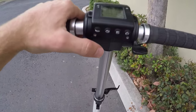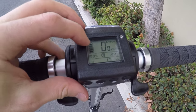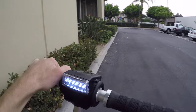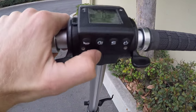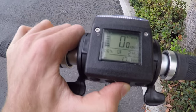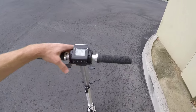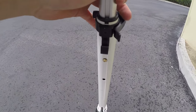Let's look at the display system. The first button is power — it chirps and comes to life. You can see battery level and speed in kilometers per hour. I haven't figured out how to switch to miles per hour. Battery is at 100%. The light starts on by default — it's quite bright with about six LEDs in there. There's also an extremely loud and ear-piercing horn. The S button changes through readouts showing trip distance and odometer. The brake lever is for regen and that is the throttle. The throttle doesn't engage until you start moving — that's a safety feature so you don't accidentally take off.